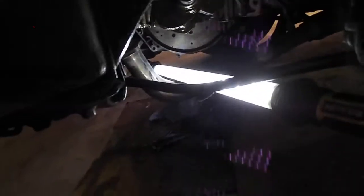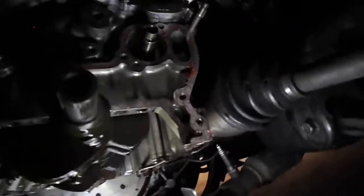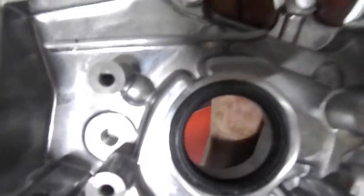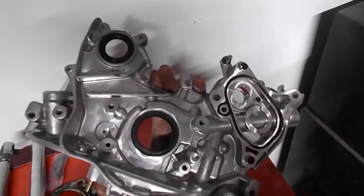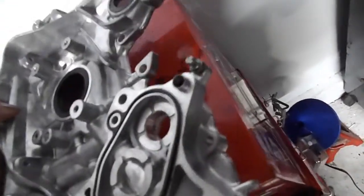To get to the oil pump, you actually need to take the timing belt off. You have to take the crankshaft pulley off and the balance shafts off. You don't have to take the water pump off, thankfully, but you have to take a lot of the timing components off the front of the engine. This is the back of the oil pump, and this is the front. This is the crankshaft seal — the timing cover bolts onto that. This is where one balance shaft goes, this is where the other balance shaft goes through, and this is where the oil dipstick goes in.